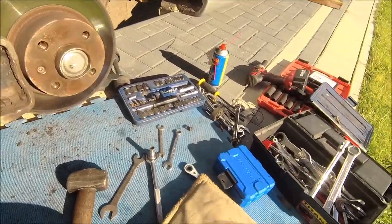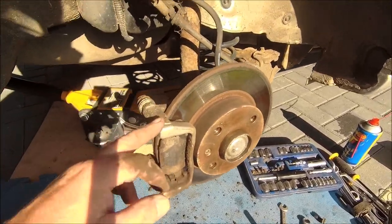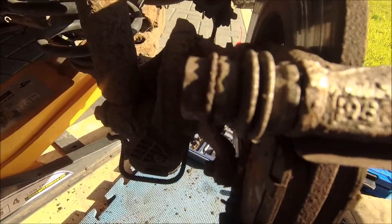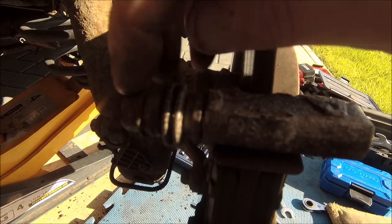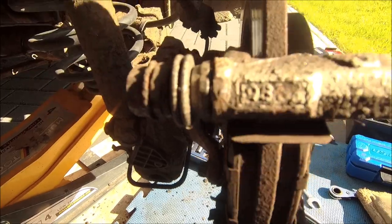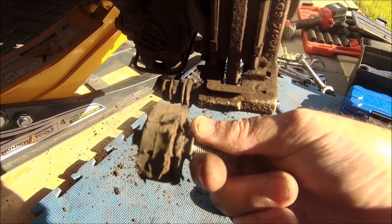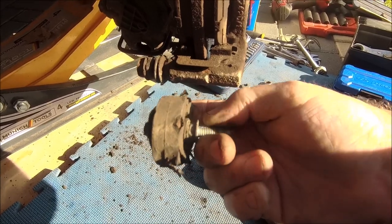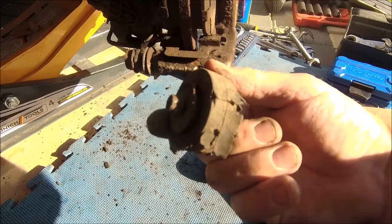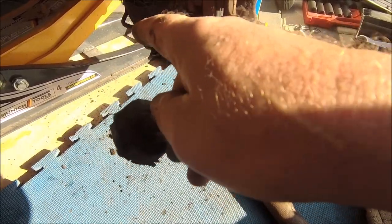Stage one - create an absolute mess, every tool out of the garage. So far: wheel off, jacked up, brake caliper off. At the top you've got one 13mm bolt and a 15mm locking bolt. At the bottom there's what I believe is an anti-vibration or anti-squeal damper - Vauxhalls of old used to squeal on the back brakes. You've got a 10mm on the back end and a 13mm just there, so that balancer comes off, then another locking 15mm. Caliper's tied up out of the way.